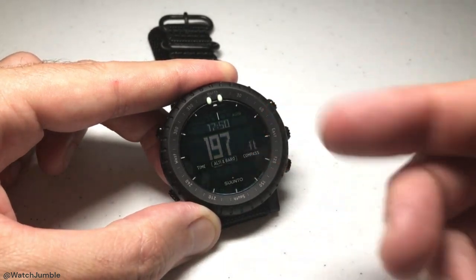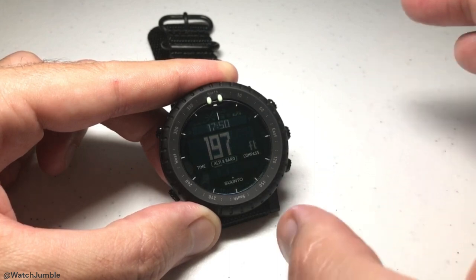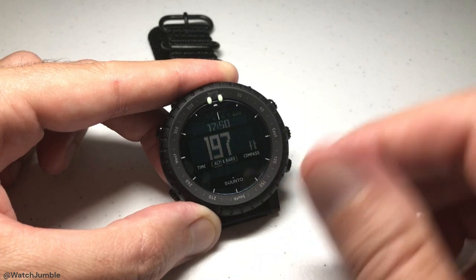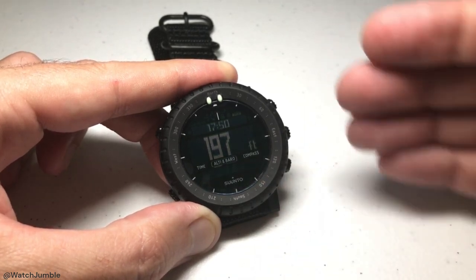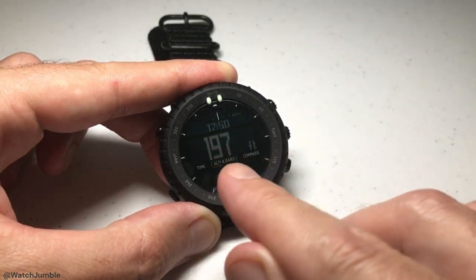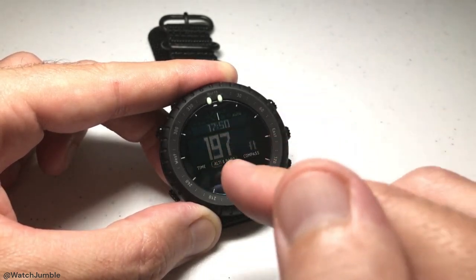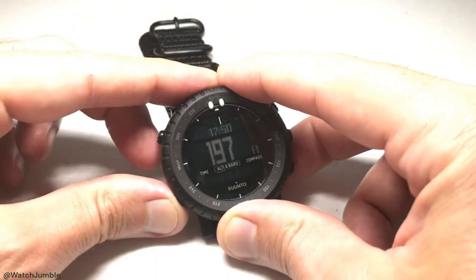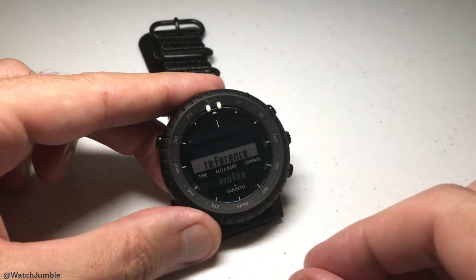Common sense tells you you're in your altimeter here. But in order to get to your barometer, you need to go into your barometer settings and change the profile so you're looking at barometer. There's also an automatic setting which basically chooses between whether the watch should use the altimeter or the barometer. I've got mine in automatic right now, but since it's using altimeter and I want to see the barometer, I need to change that. If you're in your altimeter barometer mode, all you have to do is press and hold the button on the left-hand side and that'll take you straight into your altimeter barometer settings.